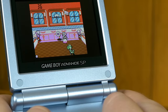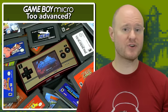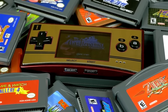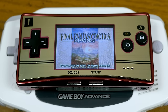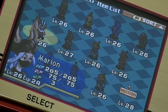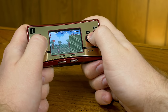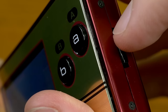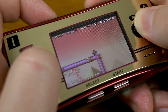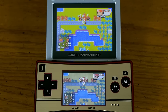The brighter GBA SP is the final device released with hardware support for original Game Boy or Game Boy Color titles. The Game Boy Micro, despite dropping the 'Advance' moniker, actually only supports GBA games. Despite not selling well, the Game Boy Micro has its hardcore fans who love its ultra-portable size and extremely sharp backlit LCD. The screen is only 2 inches diagonally — about two-thirds of the size of a regular GBA screen — so the increased pixel density creates an almost HD look. The downside is that it's just really small. While holding the L button, the volume control adjusts brightness. While pixel response is not perfect, ghosting is definitely less noticeable than on the AGS-101. However, colors are much less vivid, with the overall image appearing a bit washed out in comparison.